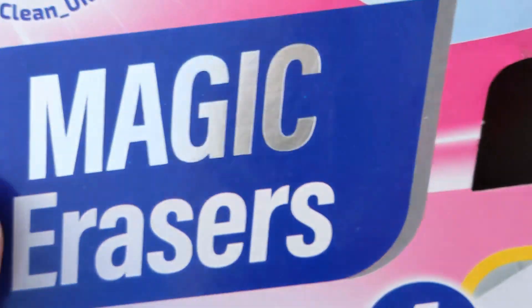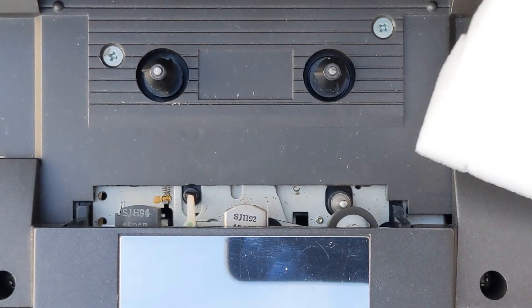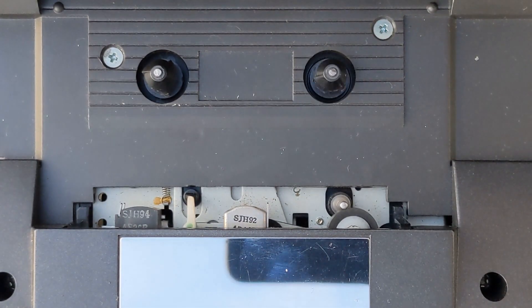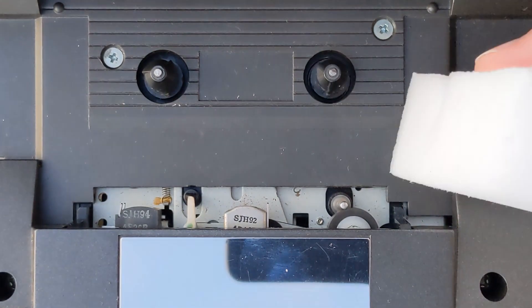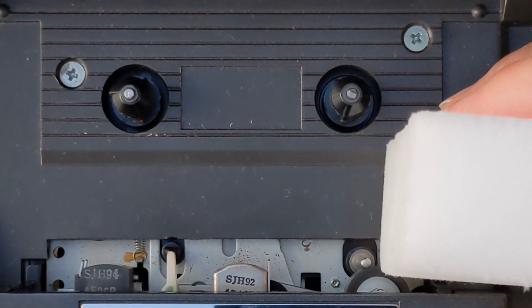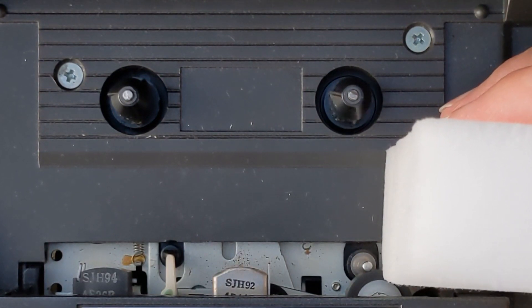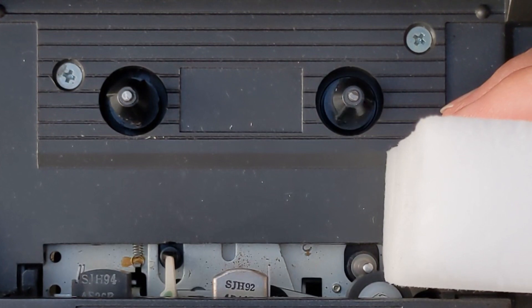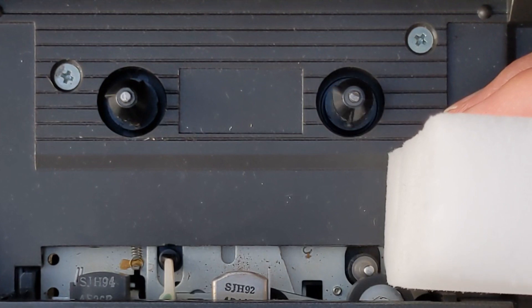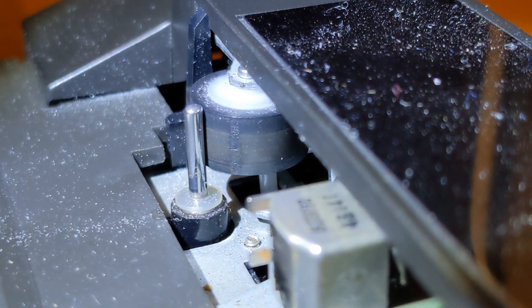What I've got here is a magic eraser, which is slightly abrasive - it's like a sponge pad. I'm going to put it up against here flat and see if I can get it to just, while I'm talking, take the top layer of the pinch roller off. There's not much of a groove in it, but it's also got some deposits on top, so I wonder if leaving this on long enough might rub off the top layer down to below where the groove is.